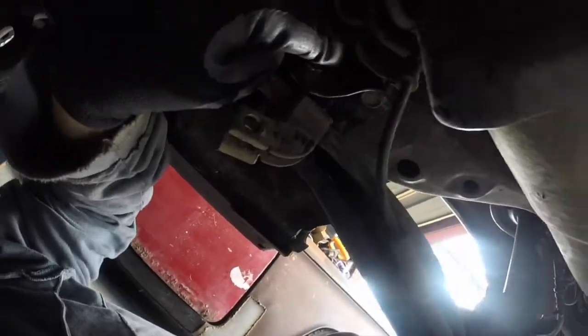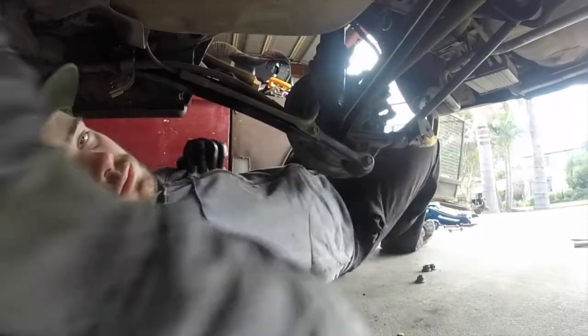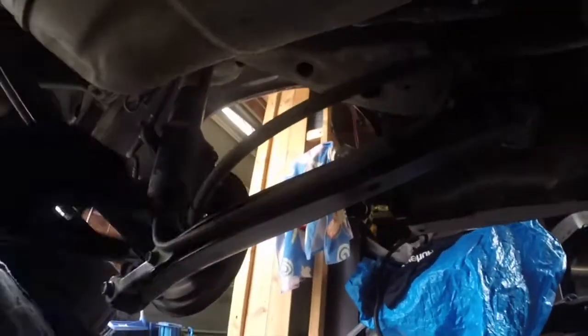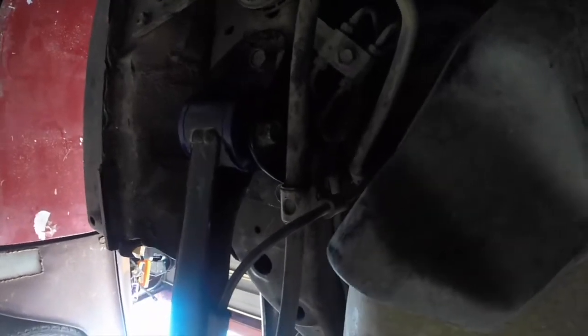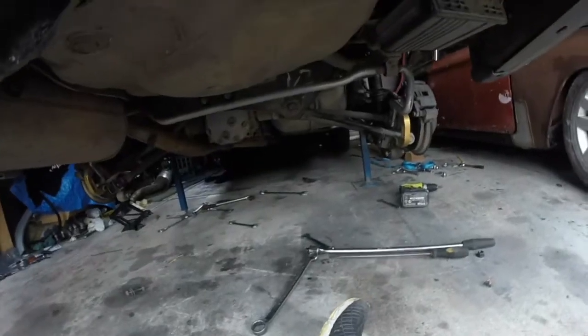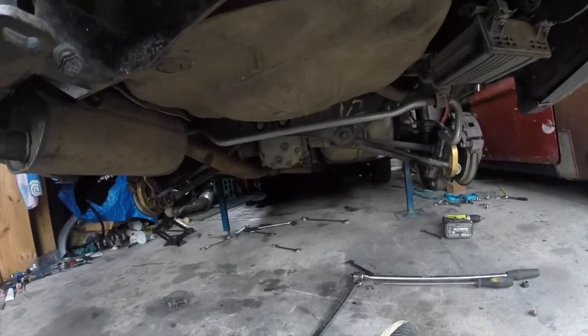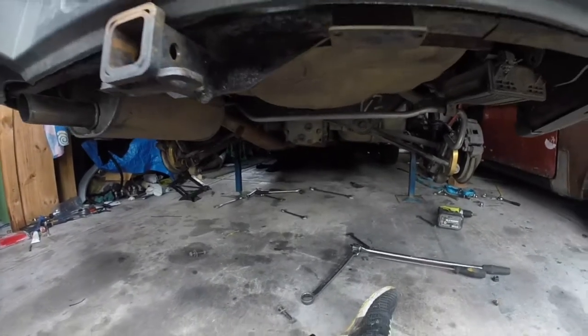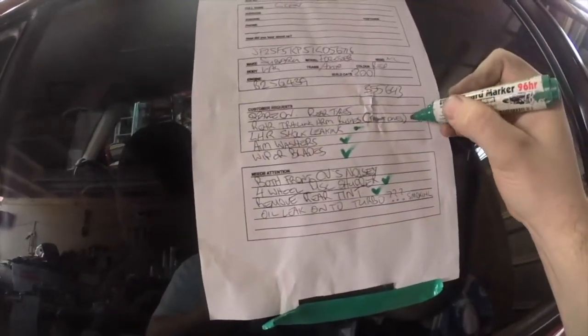Handbrake and ABS mount up here. Alright, the left side is on, all the mounts on for the ABS and handbrake. Having a bit of trouble with the 12mm bracket up here. Got me a bit frustrated, but everything else is on. All done. Now, ready for suspension. Still need to find these spring compressors. One more down.